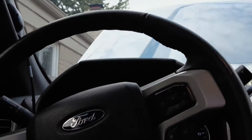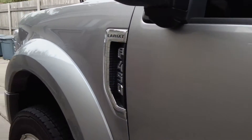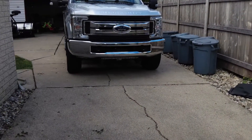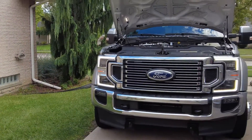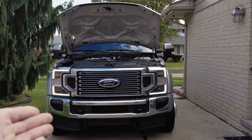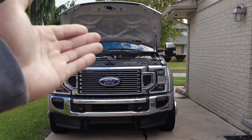There's a lot of things to consider when you're looking at a diesel truck — how are you going to drive it? If you're going to short trip it, maybe it's not a good thing. If you are going to short trip it, make sure you turn on Operator Command Regen. Go to the dealer — if they don't know what it is, you may need to print off a publication, because a lot of times dealers don't even know what OCR is. They'll charge you maybe a half hour to put their computer on it and program Operator Command Regen so you can monitor your diesel exhaust filter and do your regens.